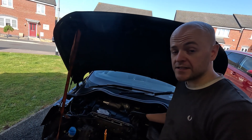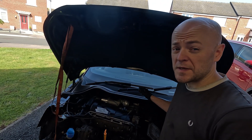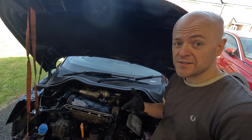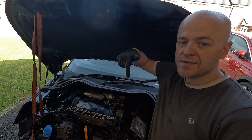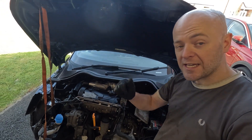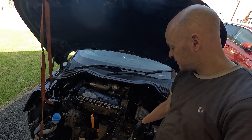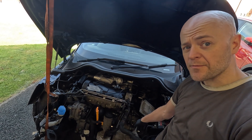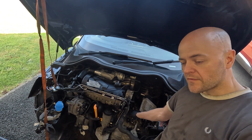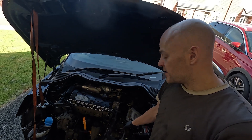A quick run through of the parts used so far. Gear selector: I've used the original five-speed gear selector from the car, which is long enough to reach the six-speed box and works perfectly. You lift the gear gaiter, put a drill piece in to hold it straight, then do the clip thing on the front of the gearbox. Once that's in it lines everything up and you put the ends on. The car side is A1, and you use the bracket that comes with the O2M gearbox out of the Fabia, along with the Fabia gear selector ends.